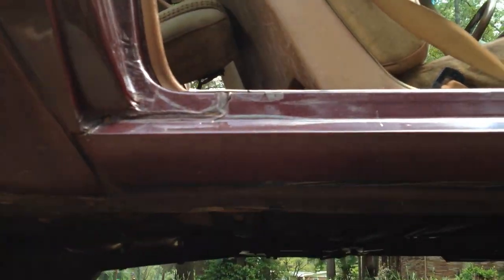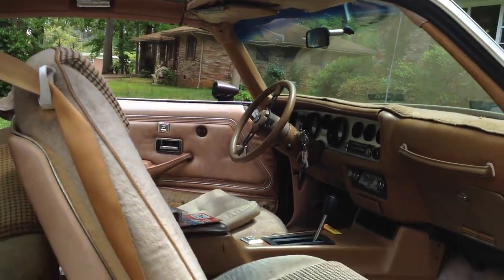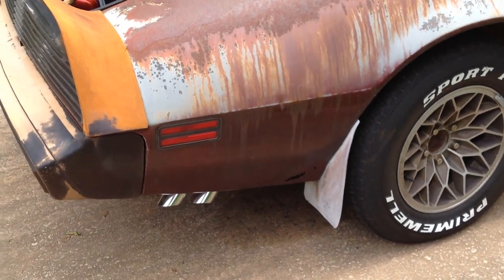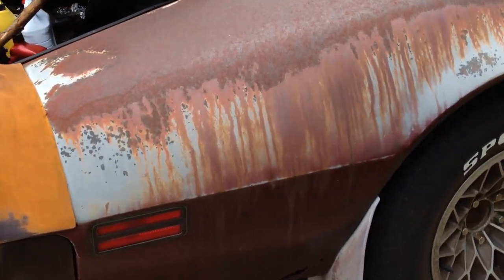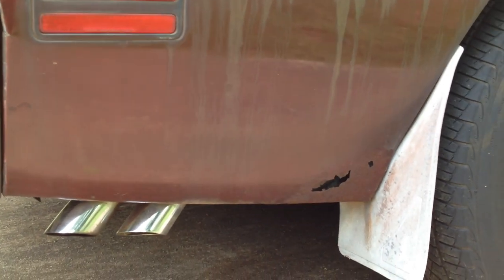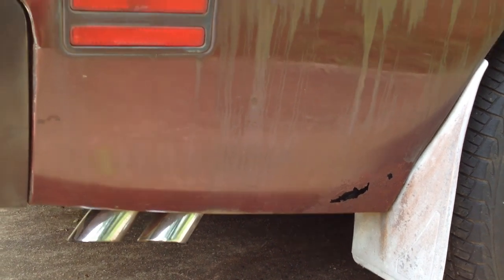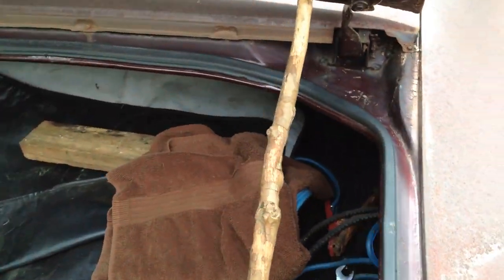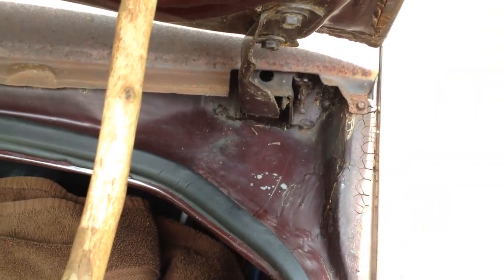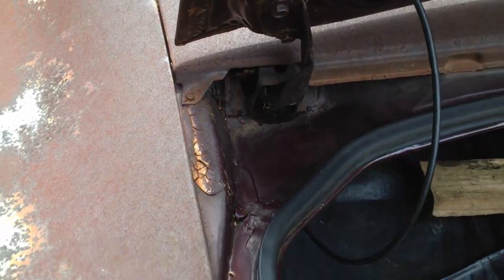The rails are clean as well. Now the way the car sat, it sank in the mud and tilted to the right, so this side right here was actually on the ground. The axle was on the ground, so the water ran out of this side of the car. That part right there is dead — the inner skin is fine but it will have to be replaced. These right here are solid as well, and we know this is where the car rusts out, but the water didn't stay in there — it ran out to the side.